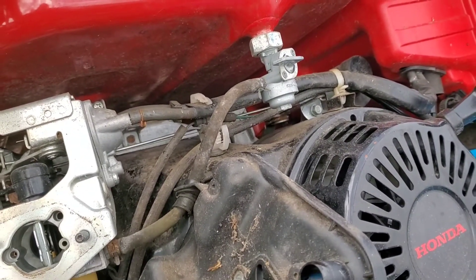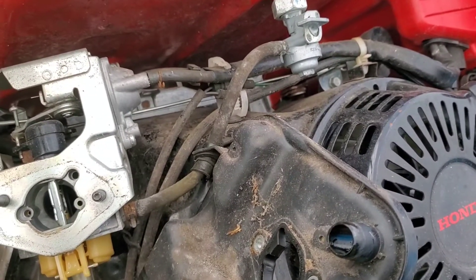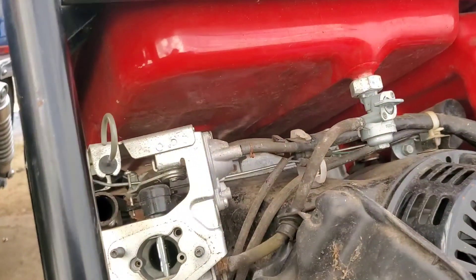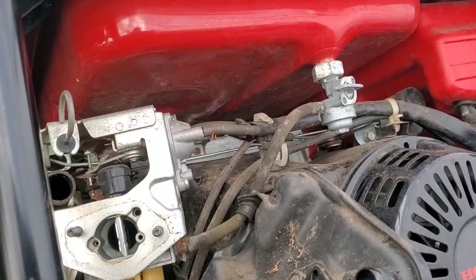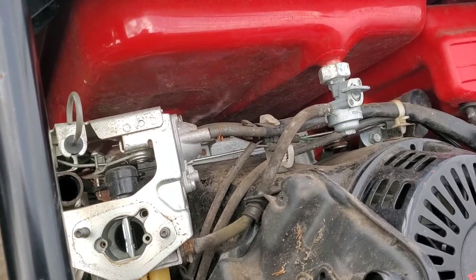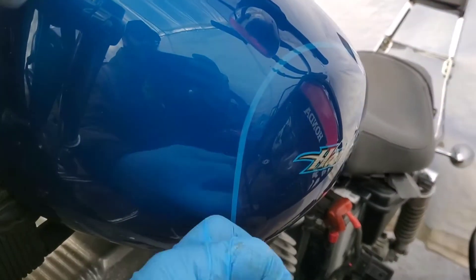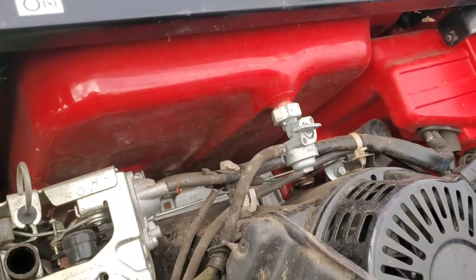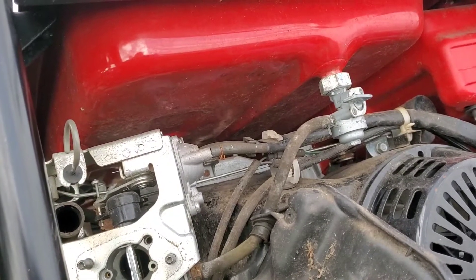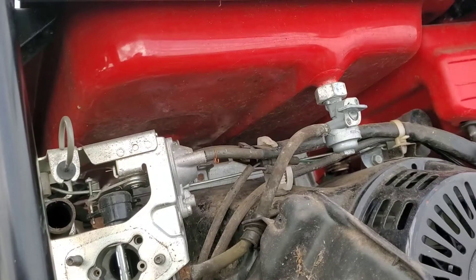It's still not 100% foolproof, but your chances are a million times better. Always stabilize your fuel. If it has a metal tank, store it full — reason being, a full tank has less room to absorb moisture from the air and the environment, and it won't allow your fuel tank to rust up. If you have a motorcycle, generator, or anything with a metal tank, highly recommend storing it full with stabilized fuel.